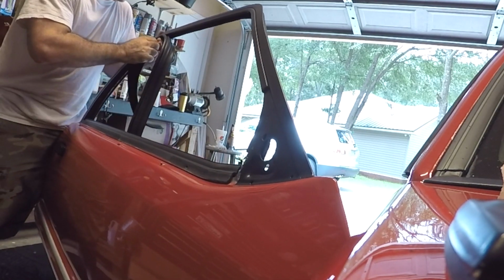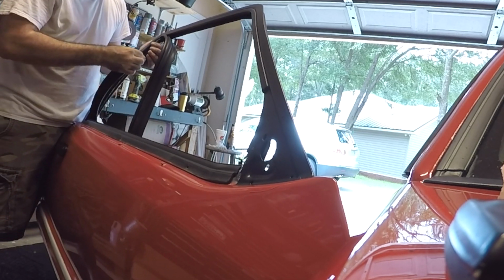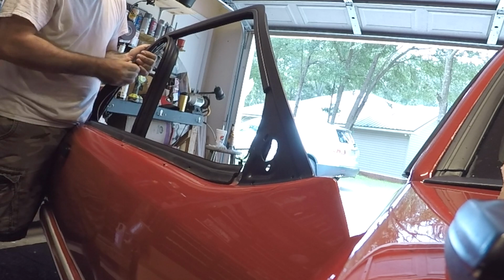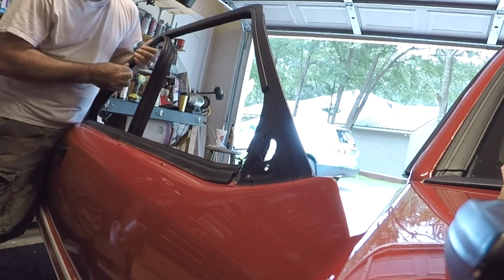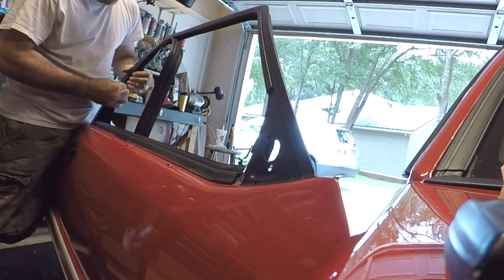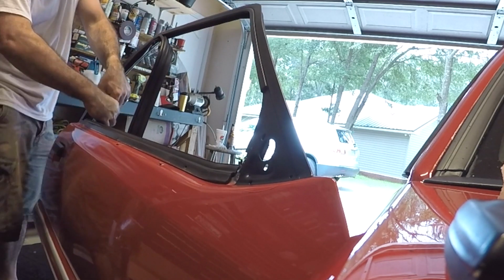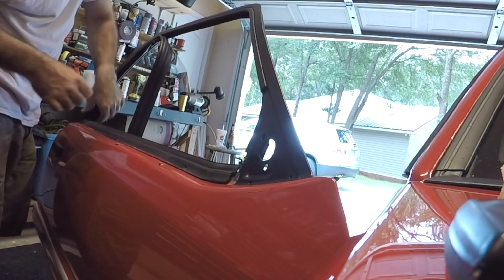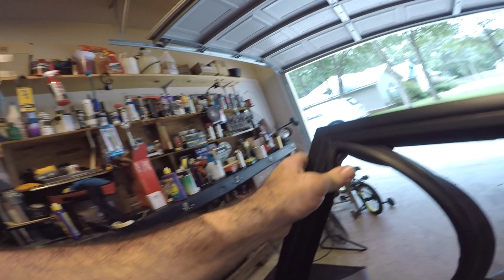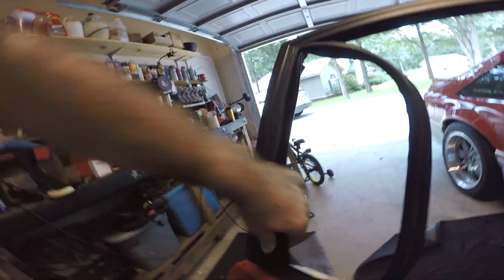Always push up on it, because over time gravity's going to want to pull it down, obviously. So go ahead and push it up as tight as you can. Get about halfway down the rail here and push up again. You always want to keep pushing up, keep that slack from building up in it. Go ahead and tuck that tail in. So that's it. You just simply want to start in your corner here, get your tail started down here, that's fine.